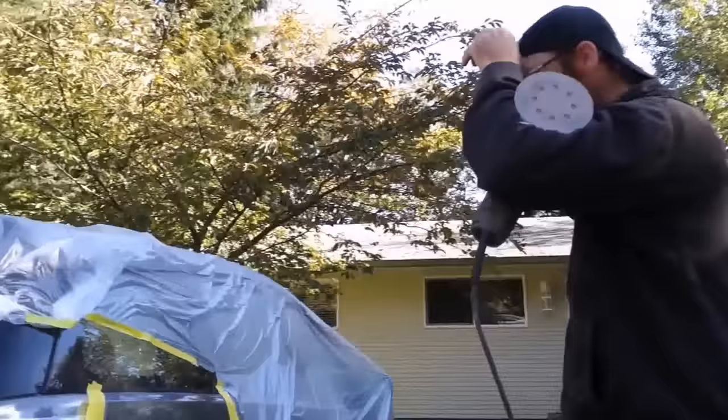Okay, tell me again, you sanded it with what? I sanded it down with 400 grit. 400 grit, okay. Okay, so this time you put the putty over top of the primer. Okay, so you can do actually both? Minor imperfections. It's more designed for this than the other way around. Okay, I see. Just to fill more of the minor imperfections.